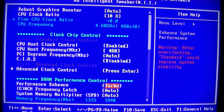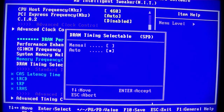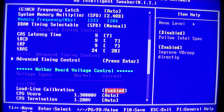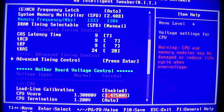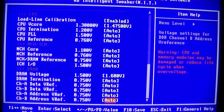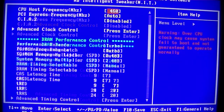Don't worry about performance enhance. Multiplier at 2.4, the lowest for the memory. We'll do a manual DRAM because I know this RAM runs at 7-7-7-20 all at 1600 megahertz. LLC enabled and Vcore 1.475 — that should do us for now. 1.6 on the DRAM as well, and that'll do for Intelligent Tweaker.